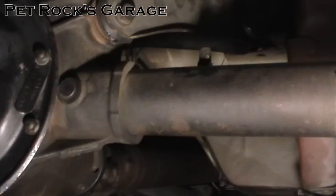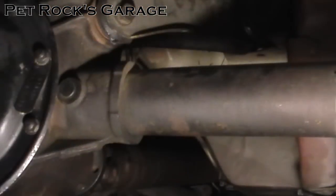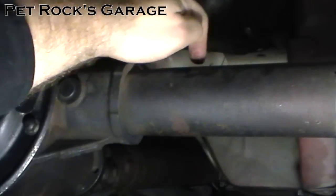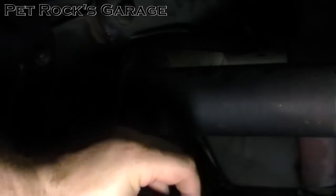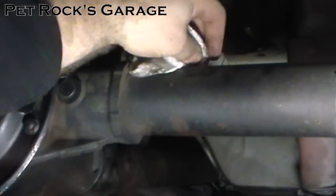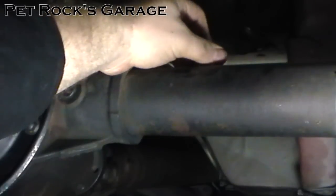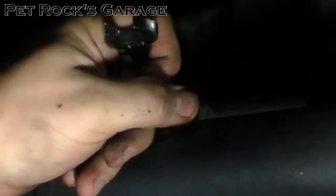All differentials have some form of vent to relieve air pressure as the oil expands when it gets hot. On this one it's a half-inch nut that you just loosen up. On ones that take a hose, just look through and make sure it's nice and clear. It's also a good idea to take a pick and clear out the hole to make sure it's open, then take some brake cleaner and shoot it through the hole. Take a rag and clean out the bore, then apply a little bit of anti-seize and reinstall — just snug it down.